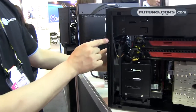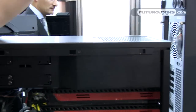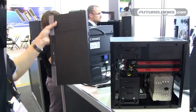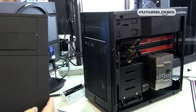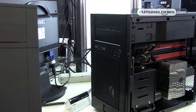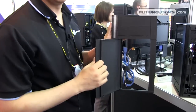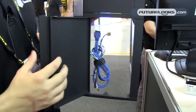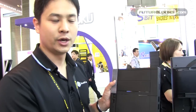Fan filters are very easy to remove. There's a fan speed switch for the front fan, independent power supply air intake, and a magnetic air filter on top. Just like the TJ04-E and KL04, we have two different front panel models for the same body: one is a completely aluminum front panel, and this one has mostly plastic but with a nice aluminum trim. One configuration will have two 120mm fans and is more geared toward office or silent computing, while the other with the aluminum front is geared toward the enthusiast for higher performance.